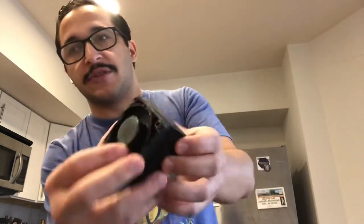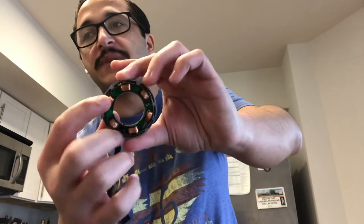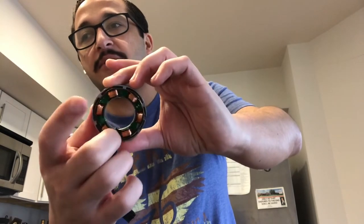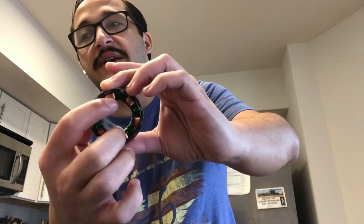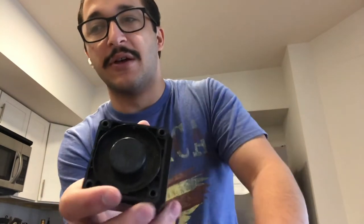Okay. So this is completely sealed off, and via electromagnetic induction, this coil produces, I guess that's a three phase. So positive, negative A, positive, negative B, positive, negative C. So a three phase electromagnetic field that spins this pump around and gets the water through. So you use the electromagnetic field to wirelessly move the thing so you don't have any water anywhere here. And you can hear that magnet in there.